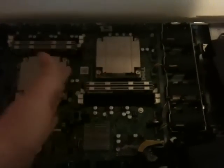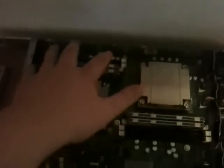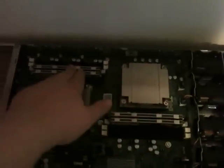Now that the shield is removed, you can see there's dual CPUs. Now, you might not have dual CPUs — you may have a single CPU with a dead board or a dual CPU board. On a dual CPU board where you're using two CPUs, you need to make sure that there's RAM on both sides of the board, so both CPU1 and CPU2 have RAM.